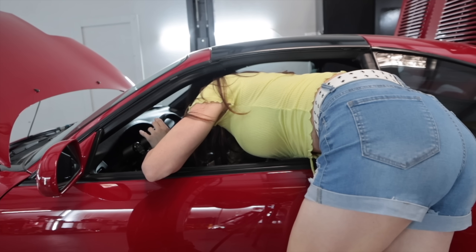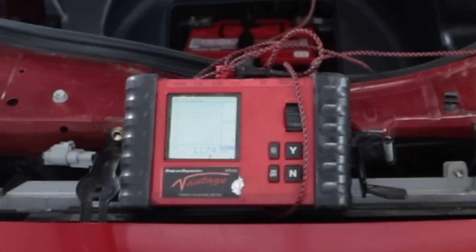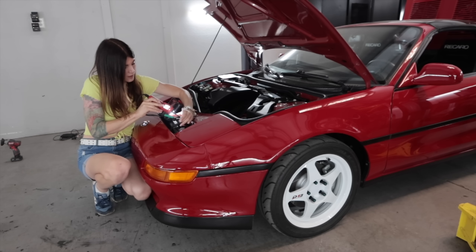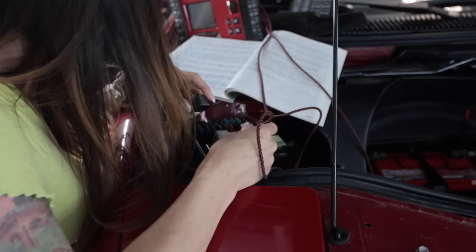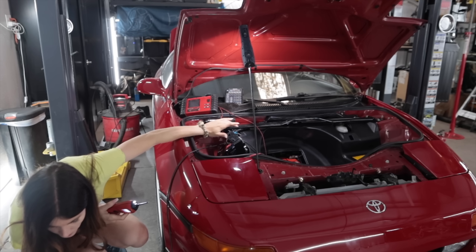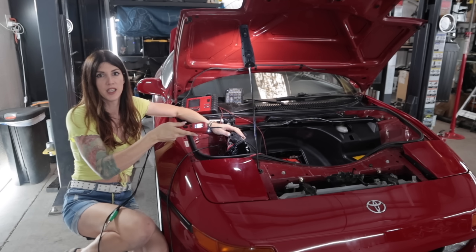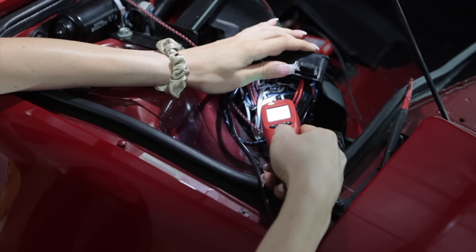Turn off air conditioning — AC is off. I have 12 volts present at that motor. It's not turning on because it should be switched ground from the relay, and I have nothing on the other side. Fan works. I suspect that relay number three is not getting anything — yep, I have nothing. Fan relay three is not doing anything, that makes sense — that's why this is not working at all. This is quite possibly one of the most confusing things I've done in a while. By applying a ground to fan relay number one, terminal one, as the AC amplifier would, this will put it into low speed and see whether these are capable of running at six volts. Black wire and ground — nothing.